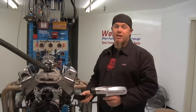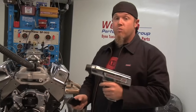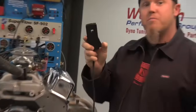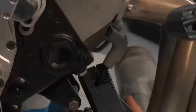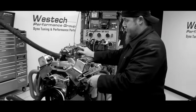Now that you've got the theory down, it's time to hook up your timing light and check your initial timing. With an MSD timing light or any other, hook up the cable to power and ground on your battery — this does not plug into the wall. Then take the pickup and hook it to your number one spark plug wire. Note that on some timing lights there's an arrow that points in the direction of the spark — that arrow needs to point at the spark plug. Every time the number one spark plug fires, this sensor picks it up and creates a strobe effect so that you can read the timing mark on the balancer.